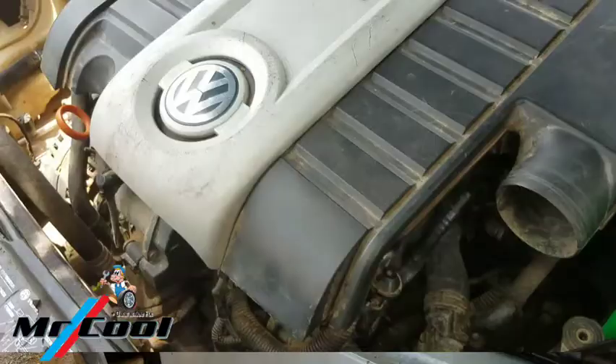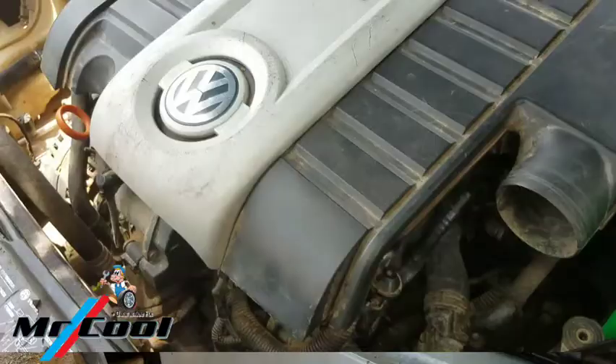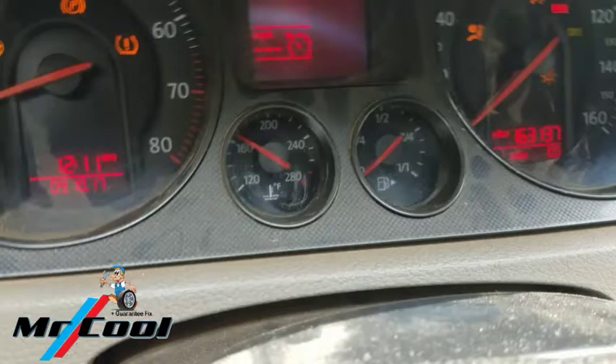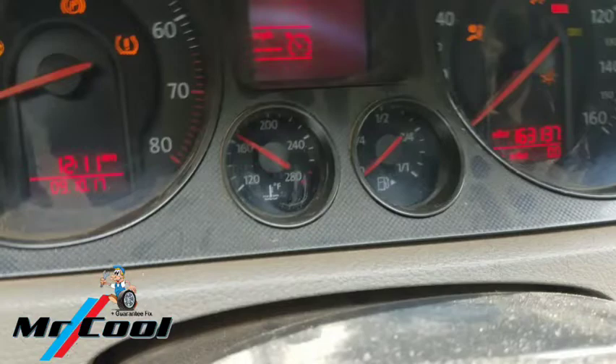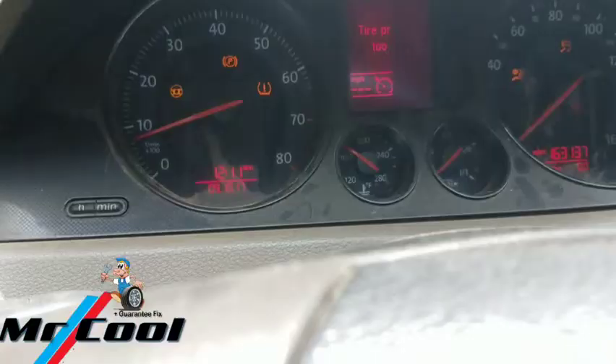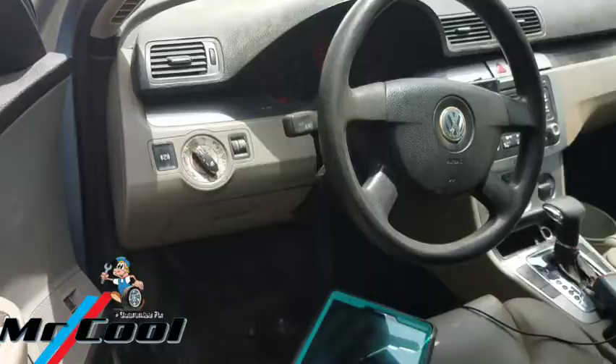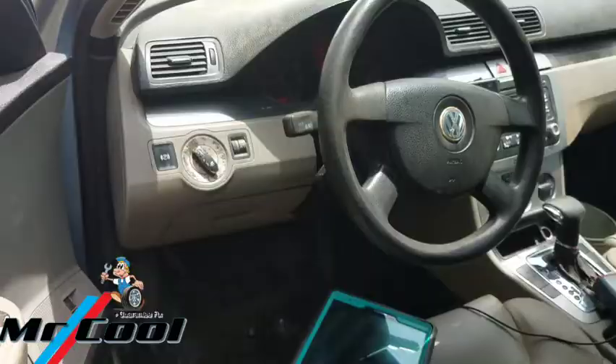As you can see right now, this engine is working fine. Look down here — the fan won't come on. A lot of you will also notice the temperature gauge hitting 200 or even above. Within that same area, the oil light could start flashing. If you start seeing the temperature hit around 200 or above 240 without the fan running, you know you've got a problem with the fan control module.